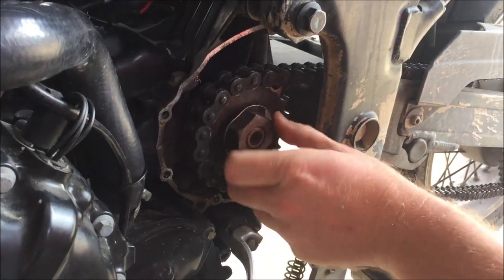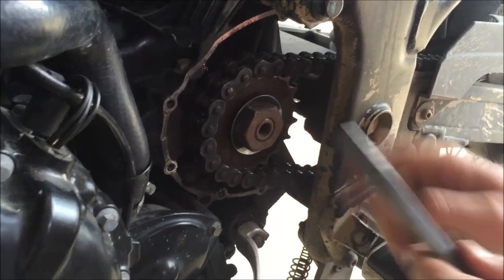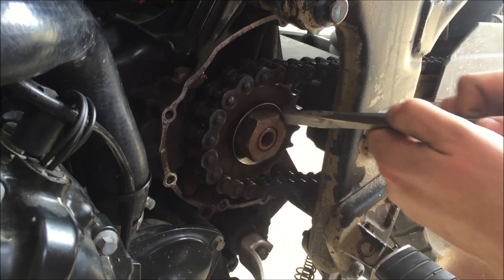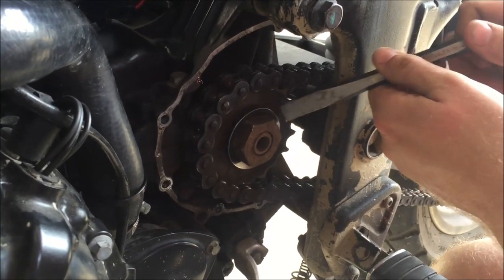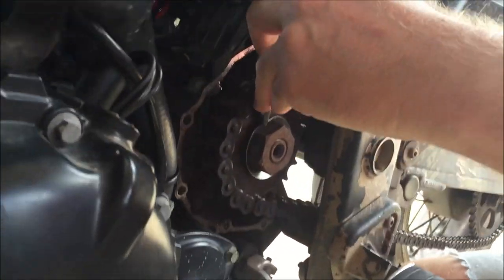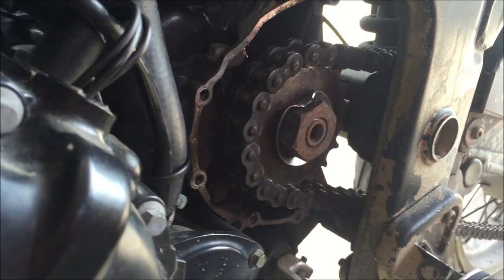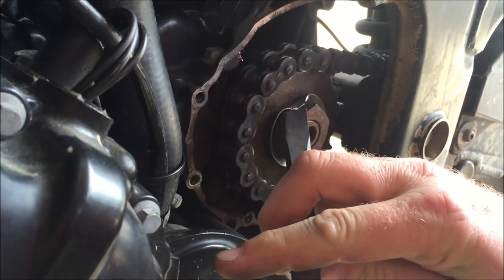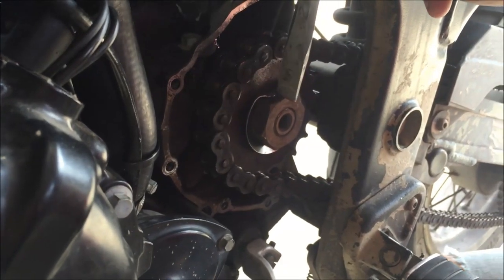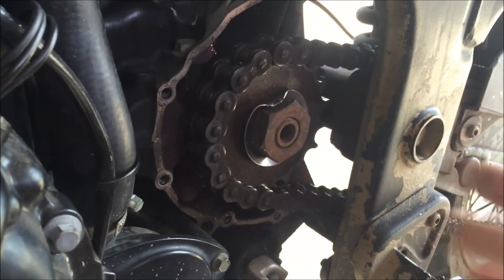I'm going to bend over one of these tabs here. What I want to do is just bend it over slightly — the only point of this washer is for the nut to not fall off. If I smash it down flat, it's going to make it hard to get off in the future. So I want to leave myself a place for the next time I come in here to remove it. Don't flatten this thing over completely to where it's unremovable. That's the way I like to do it — keep it accessible for the future. I'm going to go test ride the bike now and see if the noise goes away.